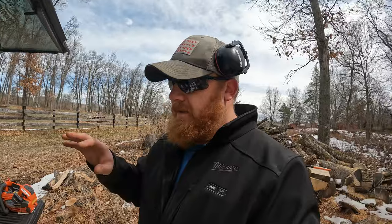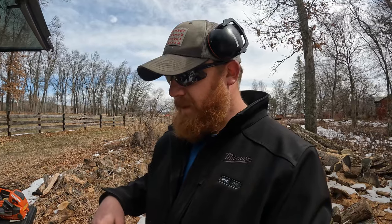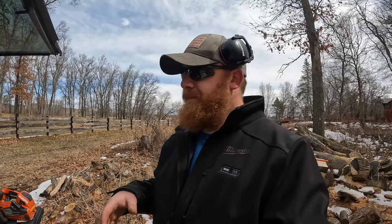Yeah, that's fantastic. A lot of guys that grab the saws right out of the box, they bar it up, gas and oil it, and they go right to work. And they're making short little blip cuts. So the saw's not gonna run its best, and it's gonna die, and it's gonna bog out in between those cuts, because it's not a long enough cut for it to tune itself in. It really needs to be ran in the wood.